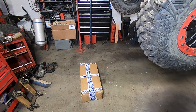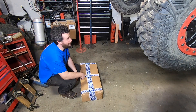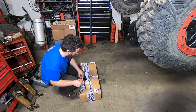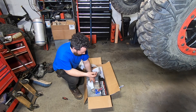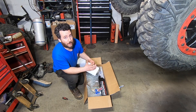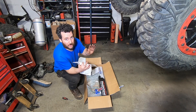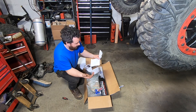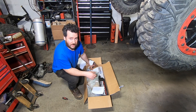We've got a couple ways we can go tonight, but a lot of viewers have been asking about what I'm doing for axles. Let's play around with this and see if there's something we can make happen. It's pretty obvious we're going to go away from the Volkswagen rear wheel bearing setup, because it's physically very big and shortens your axle length, and the service intervals on it I'm not impressed with. So we're going to go to a unit bearing setup.